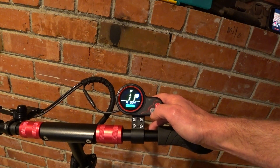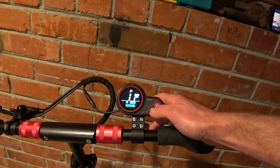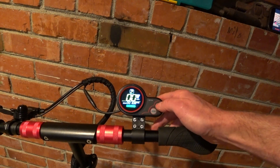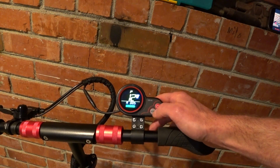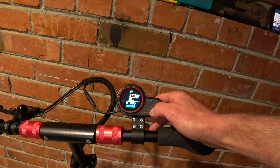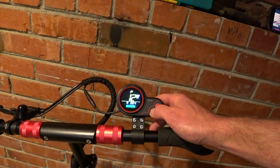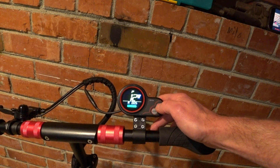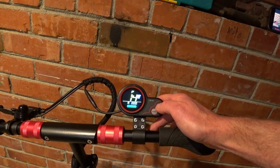P11 is the electronic braking force level. It's basically a scale of one to five. I tend to go on the high end — I actually had it at four. I like getting pretty strong electronic braking, especially with the 08 having just one brake. P12 is the acceleration potential — one is kind of gentle up to five, which is basically as high a torque as this thing can put out. I want it on five.